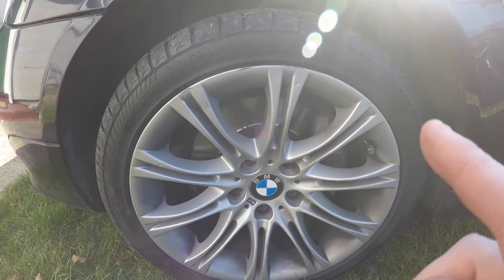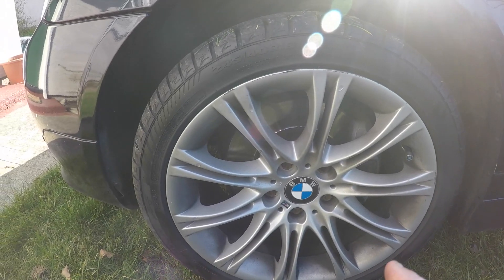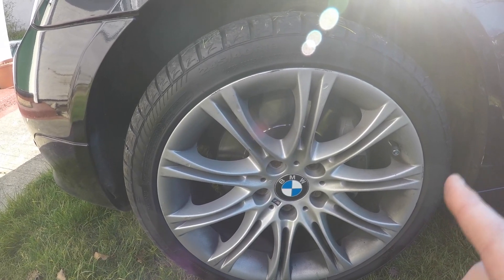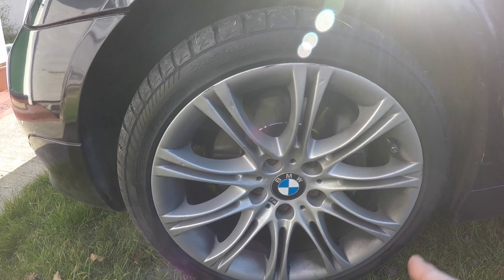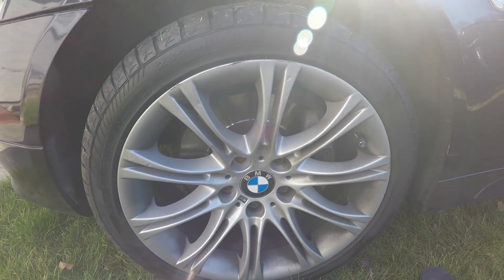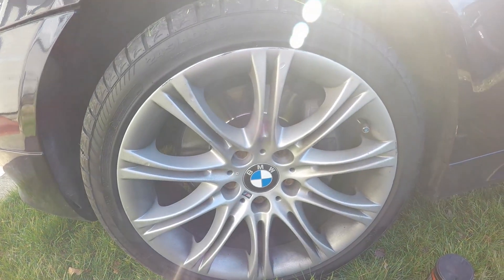Now with the new disc back on and new pads fitted, we're going to remove the front wheel. This is the front side — the side that came up on the MOT as an advisory. This is also the side that's pitted and scored, and the brake disc is completely knackered. I think the brake pads are completely worn out too, so we're going to take them off and find out why these came up on the MOT and see how bad they actually are. BMW put them on their report saying they're in bad shape and needed changing.